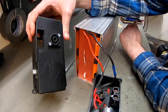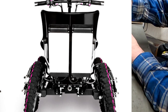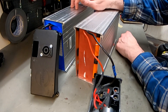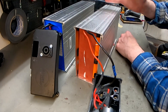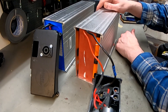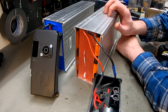This is the Golden Motor version. They have dual batteries on this off-road wheelchair. I think it's a four-wheel drive wheelchair — one battery is for two wheels and the other is for the other two wheels. Most likely so that if you get stuck you still have one battery left, or if there is a failure on one of the motors you'll still have one battery. I think it's for redundancy, and also because you cannot fit that much energy inside one of these cases since they're using LiFePO4.